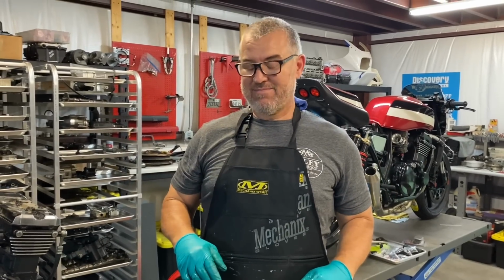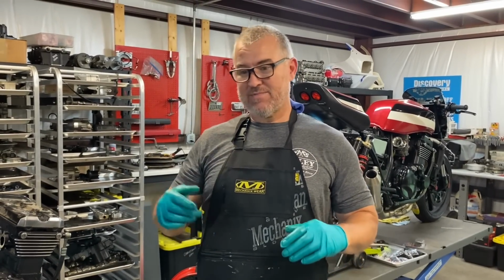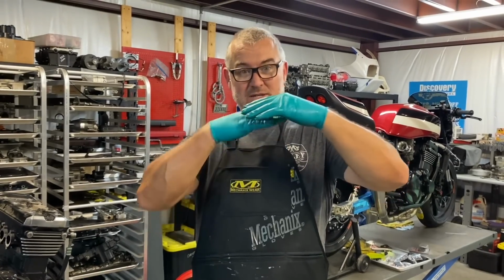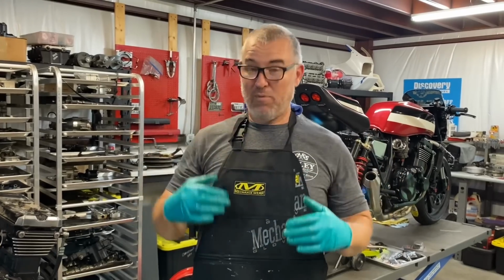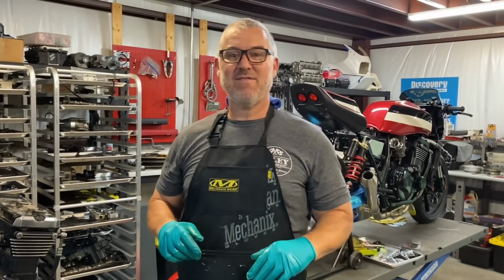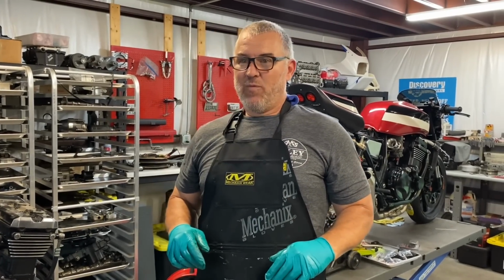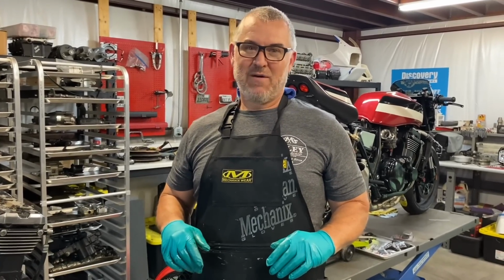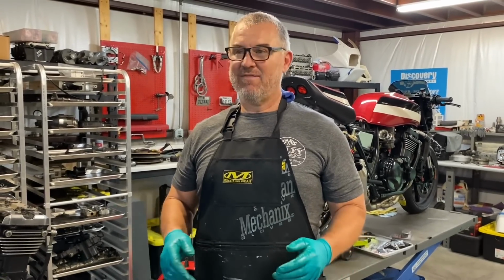And then on the oil scraper rings, sometimes they're going across the wrist pin and you have to put support rails in to support the oil scraper ring at that point. Our race pistons on our 1255 are like that. We haven't sold any of those kits for the street because we're not sure what kind of longevity they have.